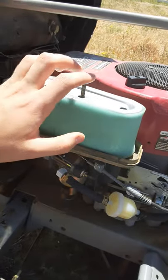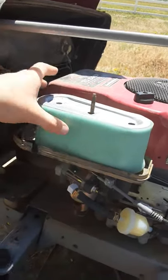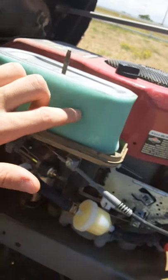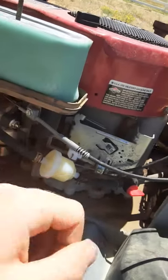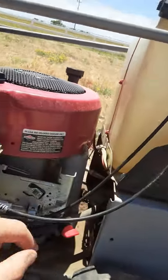This here is the air filter. I took the old one and I took it to Tractor Supply and held it up to match it. This blue thing here is a pre-filter that helps keep all the stuff out of your engine that you don't want in there — it goes into the engine. It's a good idea to oil this just lightly. What you do is you get some oil on your fingers and rub it around, then squeeze any extra oil out.